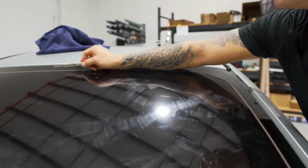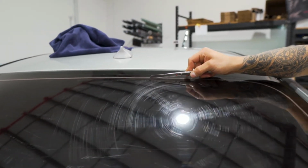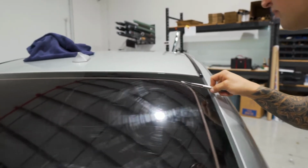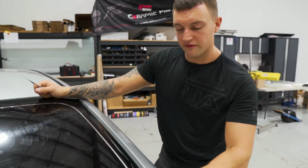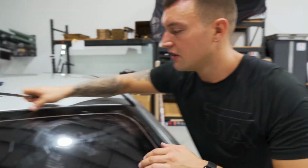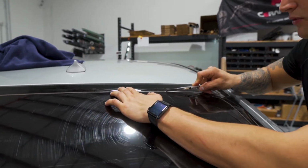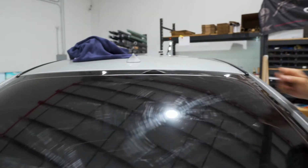And we'll start from the center up here. Following into a continuation of where we left off. All right, so sometimes you may notice that when you're cutting, you want to give the film a little pull just to make sure that you're releasing it. Sometimes when you're cutting on the glass aid, it won't cut all the way through, because you're scared to apply too much pressure. So you just got to go back over it again and apply a little bit more pressure. You can see there's a spot here where we didn't cut all the way through. We just go over that again, and everything else is good except for finishing off that last corner.